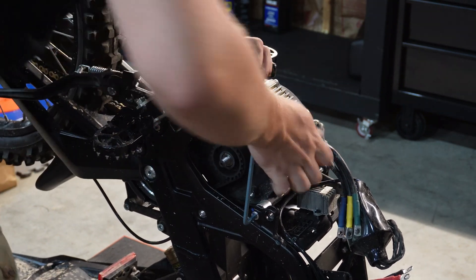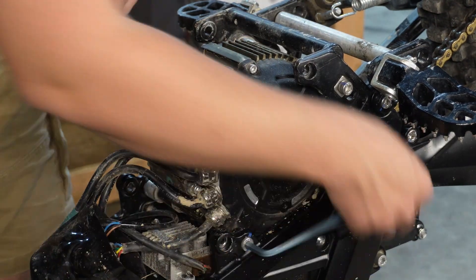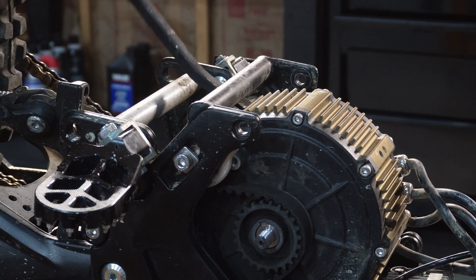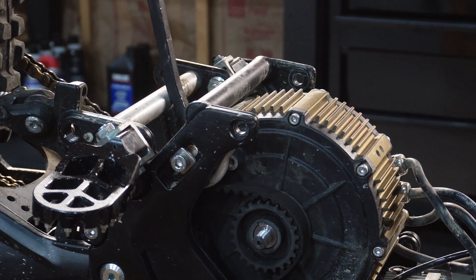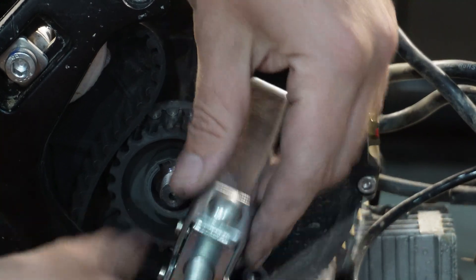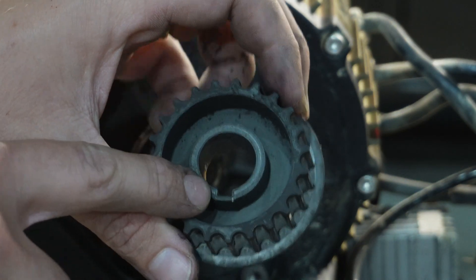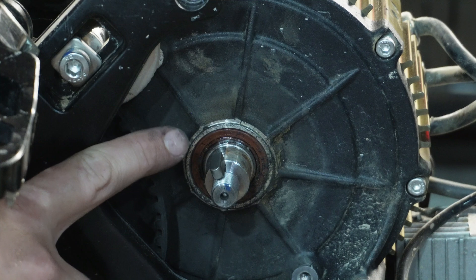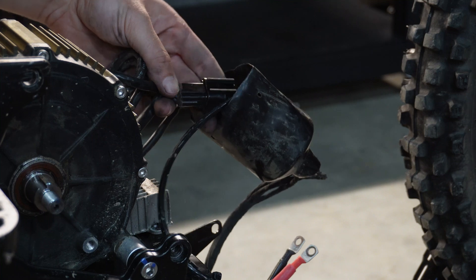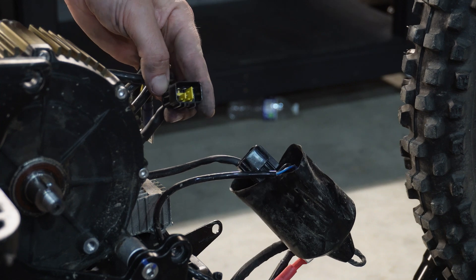Right now I'm just breaking all of the bolts loose — on both sides, there's four of them. Once you've got your engine bolts loosened, you can take a pry bar to the frame or to your peg brace to either tighten or loosen the belt drive. Sometimes you'll need a little puller tool — on this one it just slid off easily. Don't lose that little square slot key holder that goes right there on the shaft of the motor. Got one more connection on the main harness, and now your motor is ready to be removed.